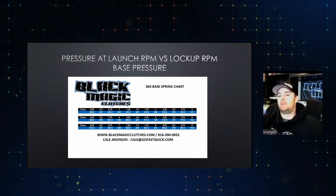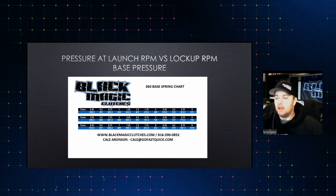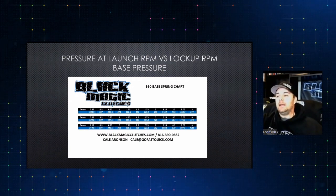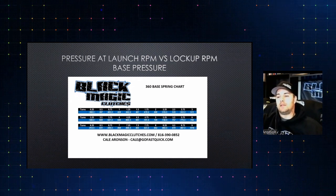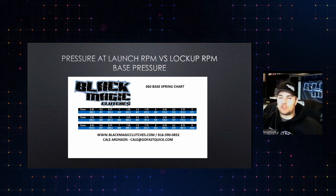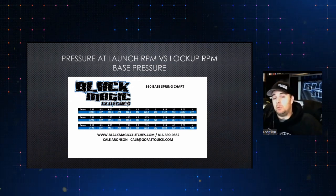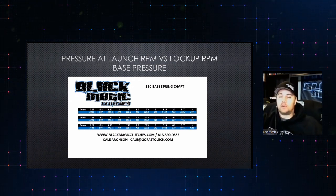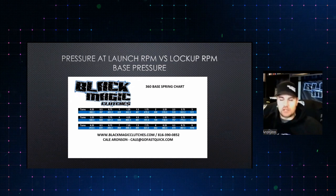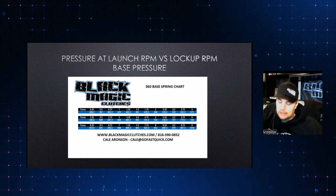I'm going to warn everybody listening, because I hope this shortens my phone conversations a little bit, that with clutches from some of the older manufacturers, older builders who have been out there a long time, a lot of times they'll tell you the base pressure is zero, or a lot lower than that. The problem is a lot of times it's not. Whether you blueprint it, meaning we go backwards to see what it is, or reverse engineer it, so to speak, or we clamp it to the dyno, it's usually significantly more.